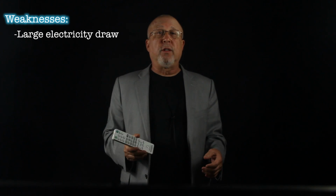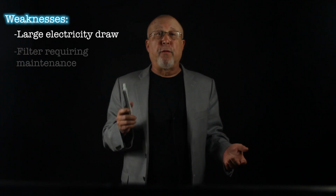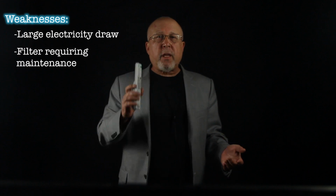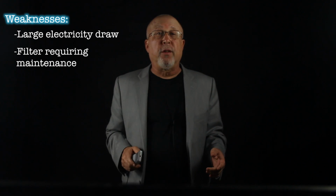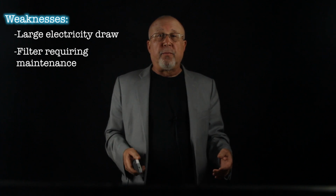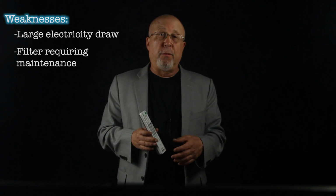One thing worthy of note is that as this is a 3 LCD projector, and that means it does have a filter to change, most DLP projectors don't, but it's becoming more common on this class of and larger projectors that the filters are really long life, in this case 20,000 hours, as long as the light source. So that's 40 hours a week for a decade. You won't have to worry much about it.